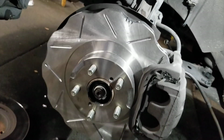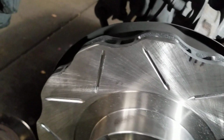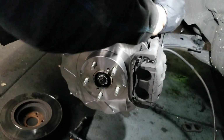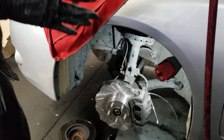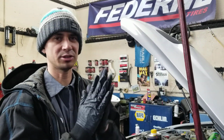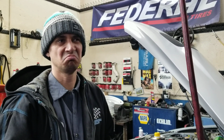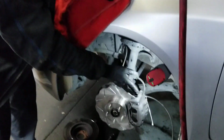Let's get a look at those. And notice how, let's see. I'm just gonna keep it going, but while we're talking. Oh, break-in. When we do a break-in when we're driving, to bed the rotors, the pads don't have a perfectly even flat surface. They're not actually perfect. There's, you know, little imperfections, and the rotor's not perfectly smooth as well.